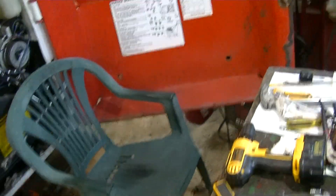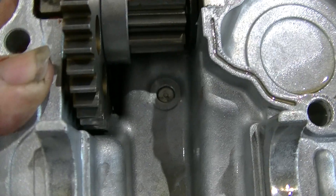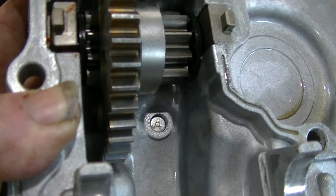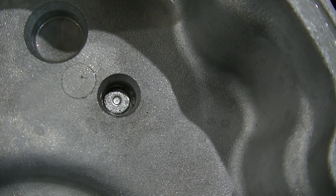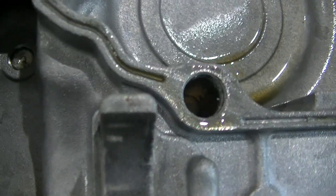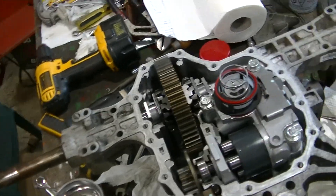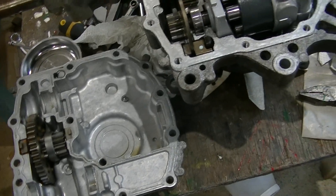My cure for that — I want to change it every couple hundred hours to keep this tractor going for a long time. Down there is a round feature that looks like it could have been a bung from the factory, and there's another one right there. I drilled it out with an R bit, threaded it to 1/8-inch national pipe thread, and put Allen head bungs into those spots. Next time I can drain that oil without going through this whole process, which is huge.